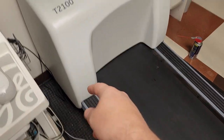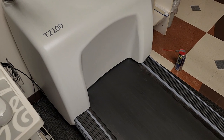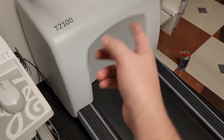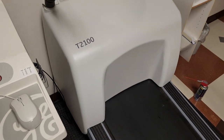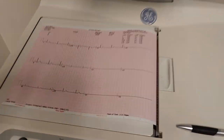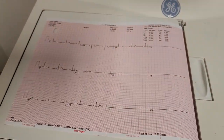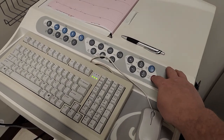Sounds pretty good, but there's a little bit of squealing. So I'm going to pull the hood and check what's going on inside it - make sure the drive belt that drives the main roller is good to go, make sure it's not cracked. But overall it's not very complex and my printout is looking pretty good. This treadmill looks like it's going to be an easy PM.